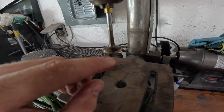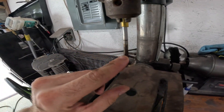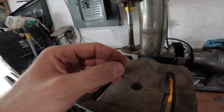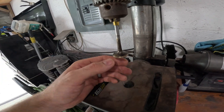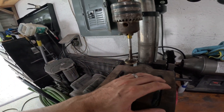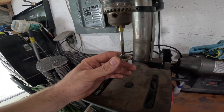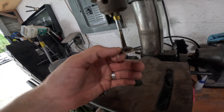So with the wire brush we took off pretty much all the carbon. Like I said, be careful with it. Don't go all the way to the top with the wire brush, just be very gentle. These are stainless steel valves — they're not 100% stainless steel, there's some sort of variant. They are very strong from the factory, so you could go a little bit rough with them. The bottom is cleaned up too.